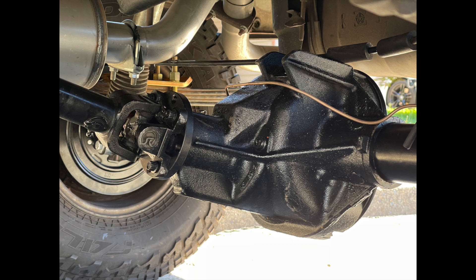Now we can start actually measuring the angles. Now that we know the difference between driveshaft types and how the setup might be different, we can contextualize what we're dealing with. In my case, I have a Ford 8.8, which has a different mounting flange than other axles like the Dana 35, Dana 44, or Chrysler 8.25. Whatever the case, only the flush mounting surface is used, so the specific yoke doesn't matter. This measuring also applies to the front axle — it's all about measuring driveshaft angle, transmission angle, and axle angle.